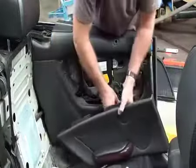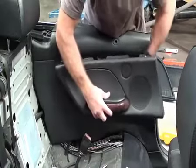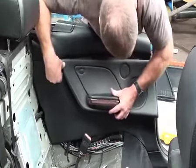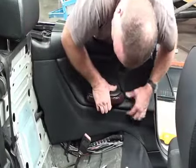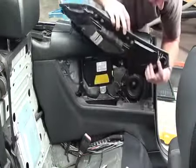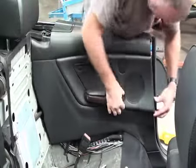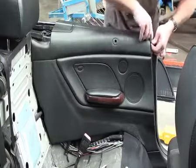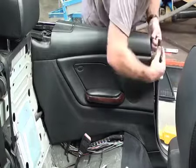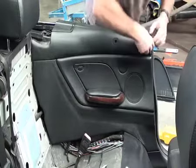The last panel — I'm just going to connect the speaker wire. These are a little bit different because it's an aftermarket speaker system. It's important that I get all these little tabs engaged correctly. The best way I've found to do it is to put it on like that and then slide it rearwards, because then it's going to connect all here as well as all the top ones. There's that single clip there that's going to go into that hole there. So put it under there, put it in, slide it rearwards, and then gently press that in. And once you've done that, you can put that rubber over that little knob there. You can get that seal and just gently slide it underneath there.